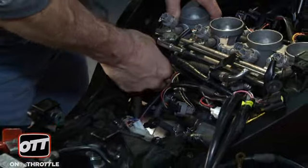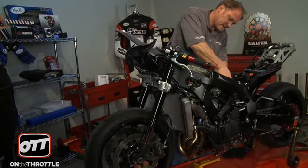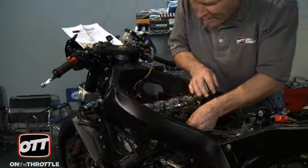That can be quite a tedious process, especially if the bike is a little older like this is and has been ridden quite a bit, because the plastic can get hard. So you might have to struggle a little bit in getting good pressure to release the injector, then plug into this component. At this point, because we're done with all the awkward components, my personal preference now would be to put the throttle bodies back into the boots and secure all the wiring around the throttle bodies, keeping everything secure there.